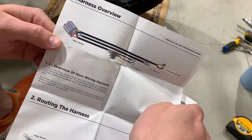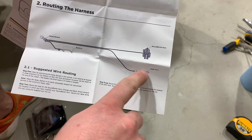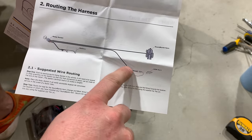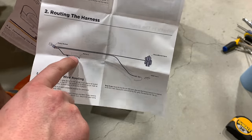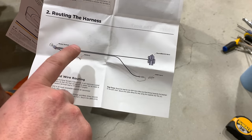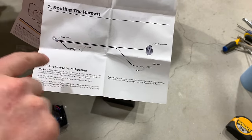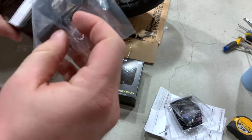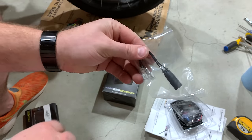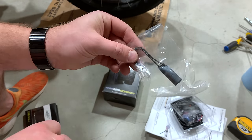So there's your wiring overview right in the harness. You're actually hooking up to the OEM horn, and then you have the relay socket and then to the battery — we're going to go directly to the battery. We're not going to be using the PDM-60 for this because I don't think the PDM-60 will have enough amperage to actually push this. We're going to do some research on that. The GS adapter allows you to hook up the Denali cables to the GS horn bracket.